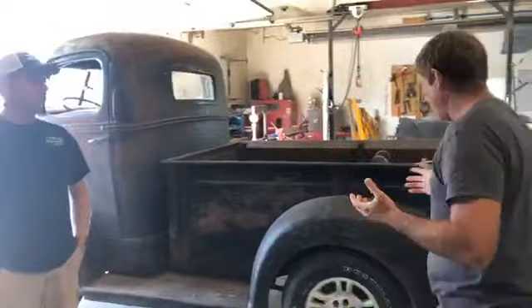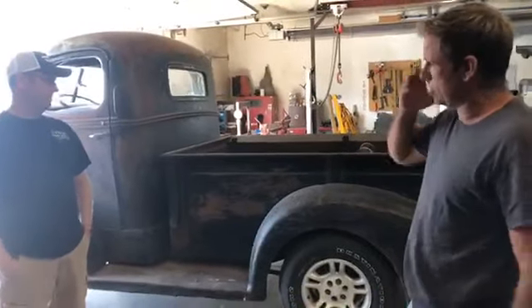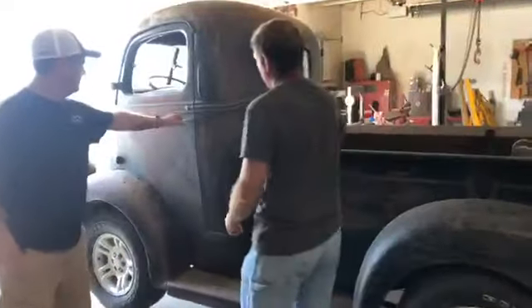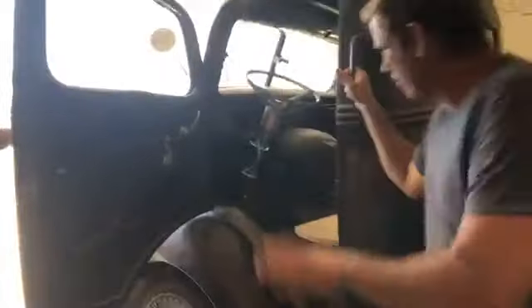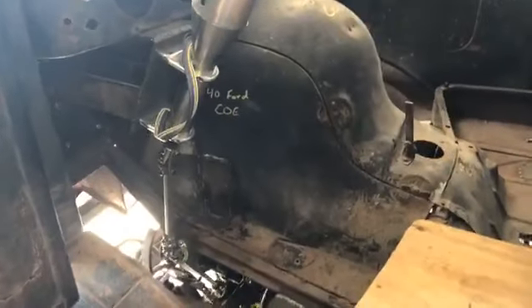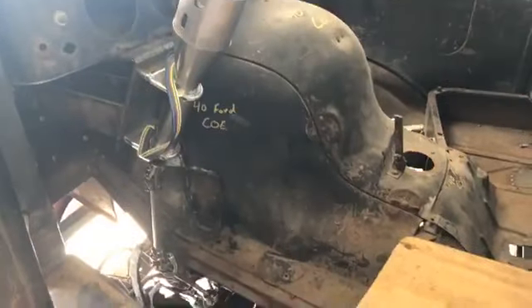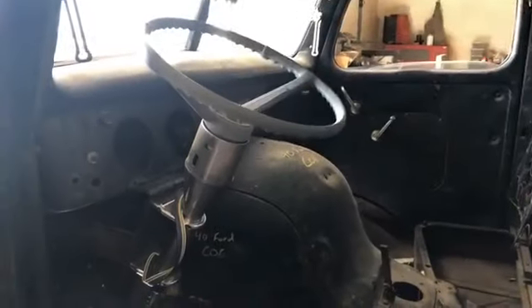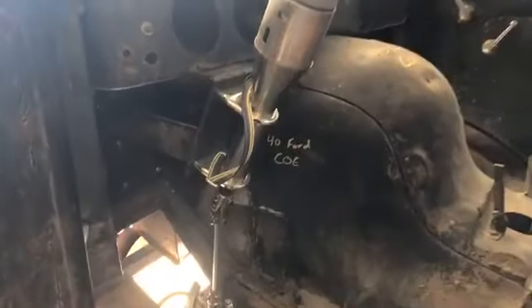As you can tell, we've got it mounted up. You can see it's still got Dakota wheels on it because it's on the Dakota chassis. Taking a look inside, we've got the steering and brakes in there. You built all the column bracketry, obviously, Mike. Yeah, that's a Flamin' River stubby column, and then we did the billet joints and got it to match up with the Dodge Dakota rack and pinion. Hand-fabricated.